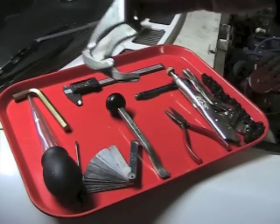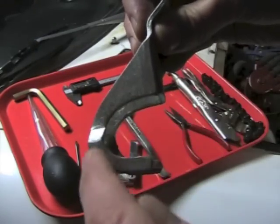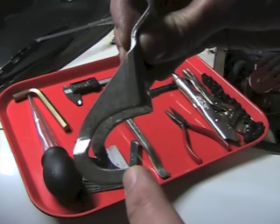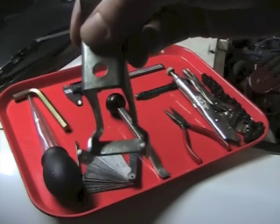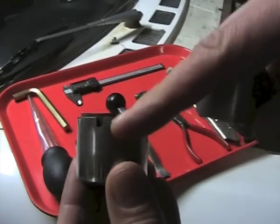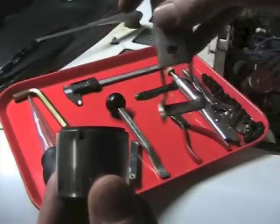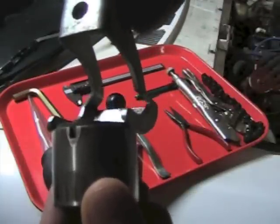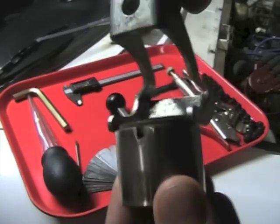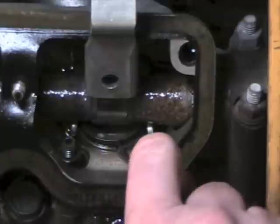This is the two-finger claw tool, and you can see it's designed to go around the camshaft and straddle the bucket tappet. Here's an example — here's your bucket tappet with the shim on top, and you can see the little notch on the side that becomes important later. Notice how the tool straddles it — it's got two small indentations built in so it can straddle the bucket tappet and still give you access to pry the shim up and get it out of the way.